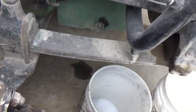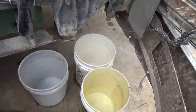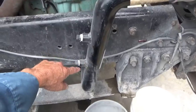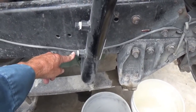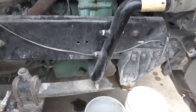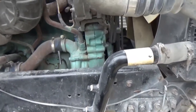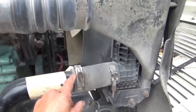Since I've had to take antifreeze out of this truck a number of times in the 16 years I've been driving it, I know I need three five-gallon buckets. Brand new pipe here, the lower pipe - that thing with antifreeze was $400. I didn't buy the antifreeze at the dealer, I got the cheap stuff at the farm supply - straight antifreeze, just regular car antifreeze. Put about eight gallons in and then topped it off with water. That pipe is going to be coming back off and I'll be changing the hose.